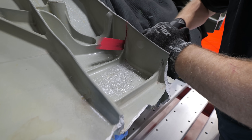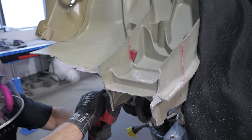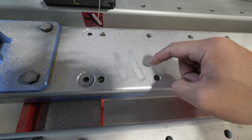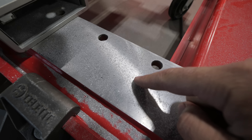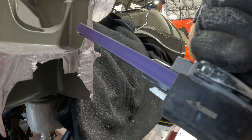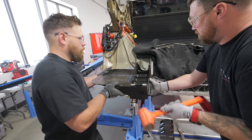The rear casting includes reference lines that are molded into the casting itself. While that guideline is important, it's more of a suggestion — Tesla has designed in about three millimeters of tolerance, so we have some wiggle room when we reattach the replacement pieces. The more exact we can make the cut the better, so after the main cut is done and the piece drops off, we use a small portable belt sander with an 80 grit sandpaper disc to clean up the rest of the cut. This is the rail section built specifically for these rear casting repairs, and if we've cut it correctly, it should just click into place like a little Lego.